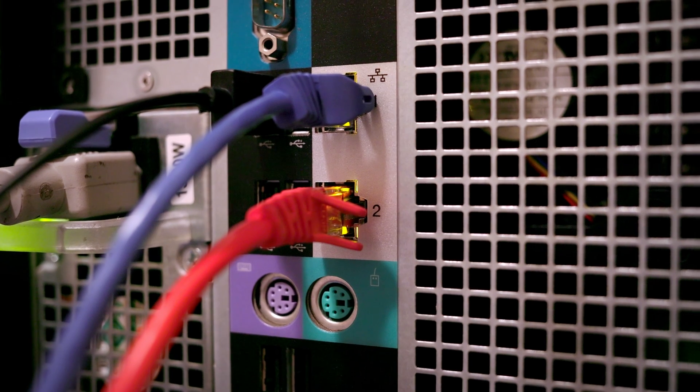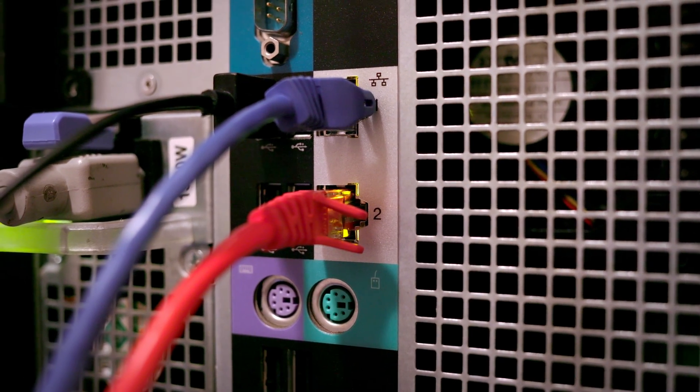With the wide range of options QSFP Plus gives you, it also means you have a lot more things to pick from and think through when setting up cables. Unlike RJ45 where you just plug it in and it links at the fastest possible speed if the cable is good quality, there are a lot of different possible transceivers.